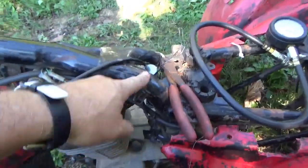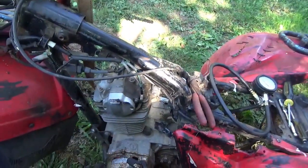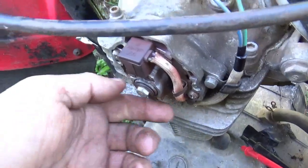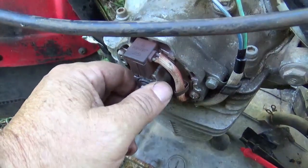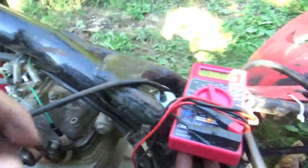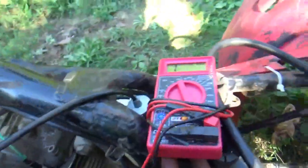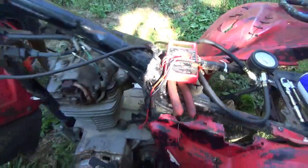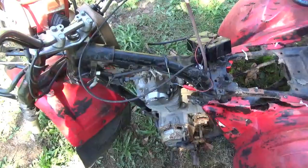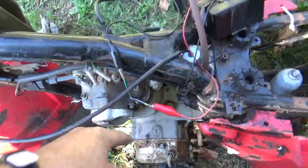We're winding down. I got the carburetor on it and the throttle. I'm finding a lot of good parts, so I'll go through that at the end. The pulse generator situation looks real healthy. The springs are hooked up, and if you do a quick continuity test on it, you come out at 35 ohms. So top end is real pretty. So we proved the engine's relatively sound.